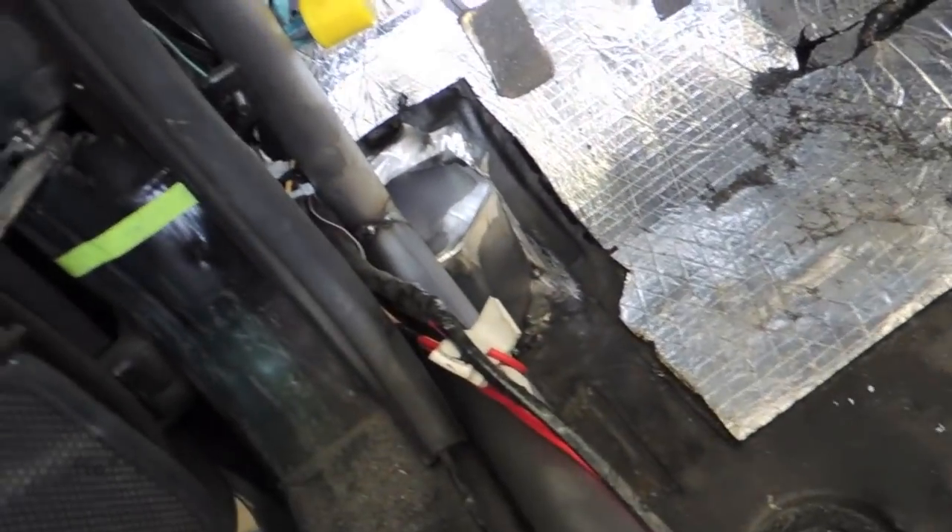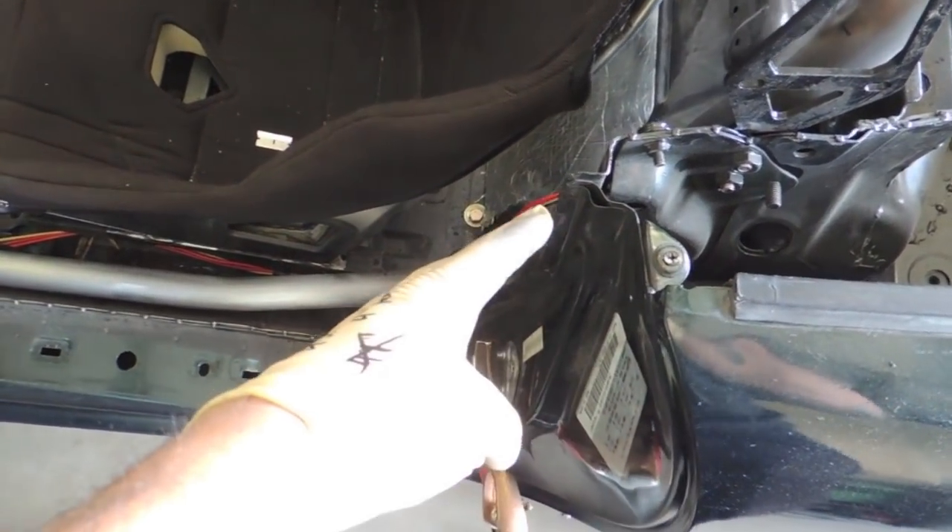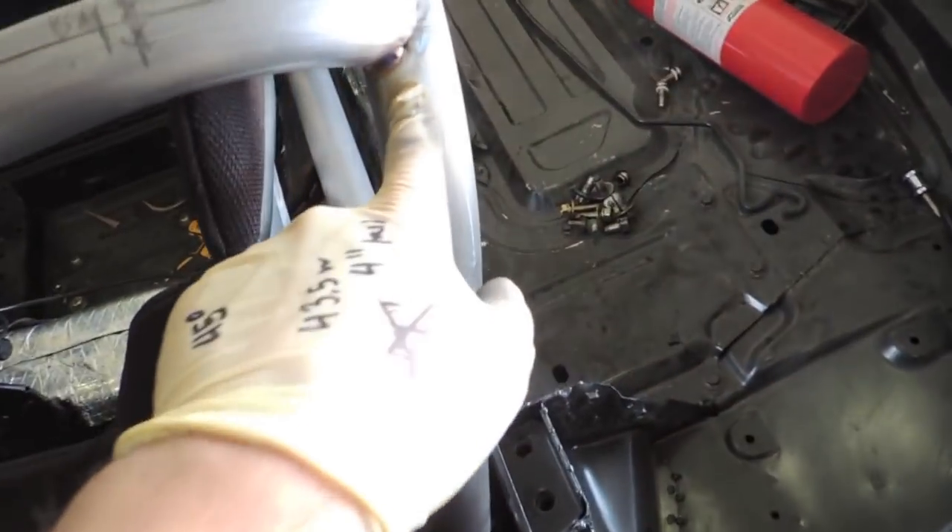We're going to throw a nice automotive clear over all the carbon parts to give them longevity and make them look nicer longer. After today I shouldn't need the hard top to confirm fitment anymore, so I should be pretty dialed and able to weld this thing out. I also figured out a trick to make welding easier — I'm not going to weld the door bars to the main hoop yet, and I won't fully weld at that joint. Instead, I'll cut the tacks, pull the main hoop and front section of the cage out as one assembly, weld outside the car, then slide it back in with the door bars and A-pillar bars separate.